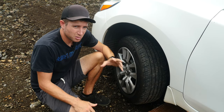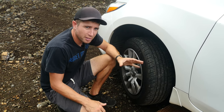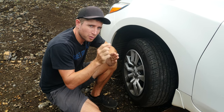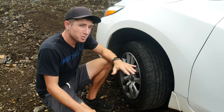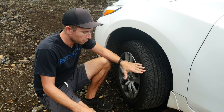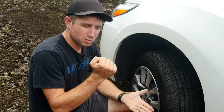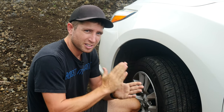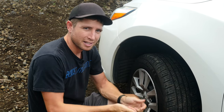That noise I was hearing with the brakes is kind of a squeaking, scraping noise, and to me that sounds just like the low brake pad indicator — when your brake pads wear out, a little metal tab scrapes against the rotor and makes that sound. The owner said the brake pads were done not too long ago, so I'm inclined to think it's something else. It's almost like scraping your fork on your plate — hard metal against something hard — and that's what's happening when your brake pads get glazed.